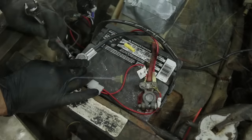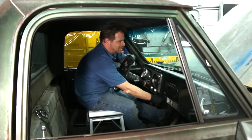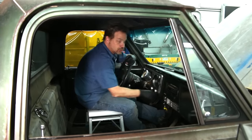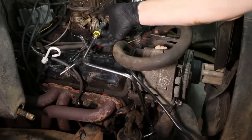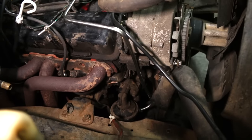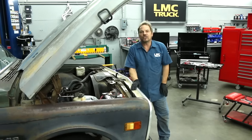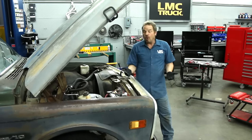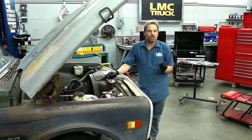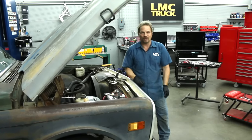Now we can check for leaks. I'm going to turn it over and pressurize the system to see if it leaks anywhere. We know 100% that our system works, our pump works, and we'll check if it's dry underneath - it is, so we're done. That threaded fitting is dry too - we're good to go, we're sealed. So now we've got a leak-free, high-flow, brand new fuel delivery system and it's stainless steel - it'll probably outlive the rest of the truck. We hope we passed on some tips if you're thinking about redoing the fuel system on your 67 to 72 Chevy pickup. Make sure you check out the LMC Truck catalog or go to lmctruck.com for more inspiration on how to make your truck project even better. I'm Kevin Tates - thanks for watching.